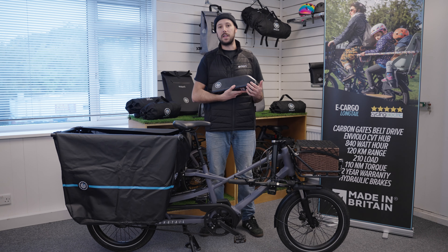We've got the charging port on this side here with a rubber bung. If you're riding in the wet or through mud, just make sure that's clean and free from any debris, especially before plugging it in to charge it, and that the rubber bung is in place and is doing its job.